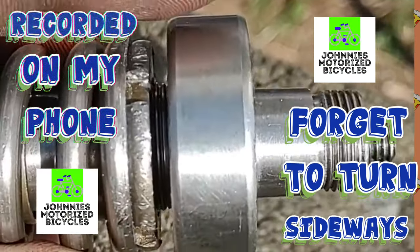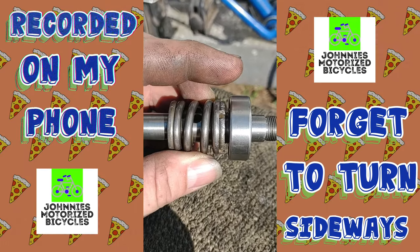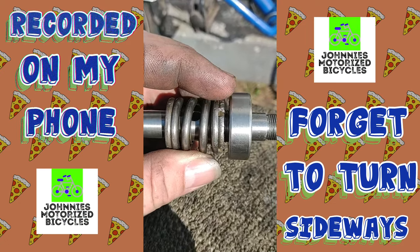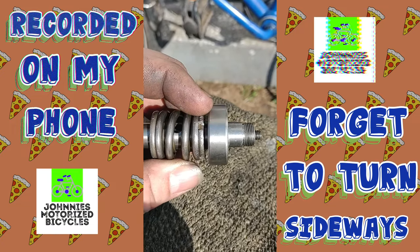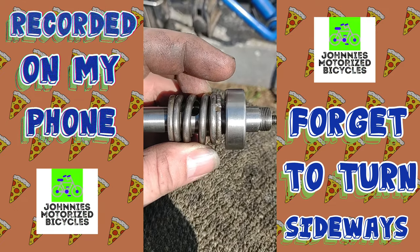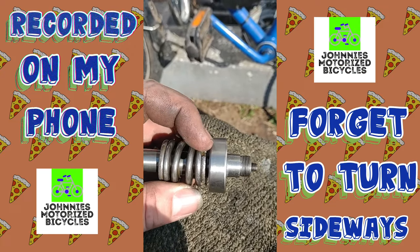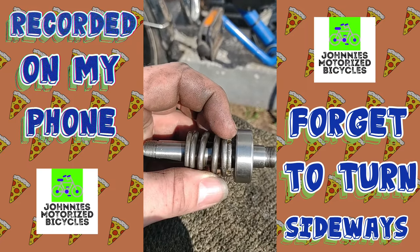It's about 2 to 3 threads, but this doesn't work on every clutch shaft. This is a YD100 and like the PK80s, the standard 80s. The Sutec one, I noticed one thread, half a thread to one thread from the bearing was more than enough to put the tension you need. But for the YD100s, I find for my body weight and the power I try to run, it needs to be at least 2.5 to 3 threads from this side of the bearing that you can see exposed here.